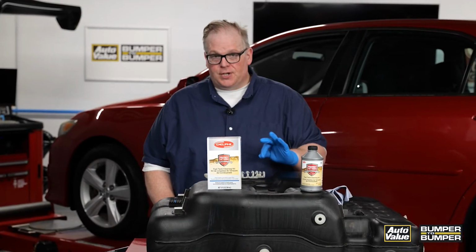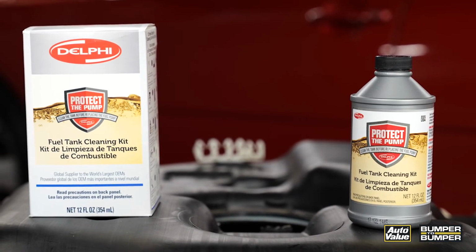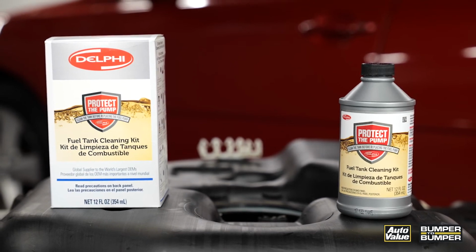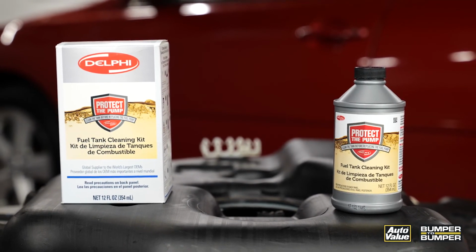Also, another suggestion, make sure that when you pull the fuel out of the tank, if you intend to reuse it, chances are your customer is going to come in with a full tank of gas. Make sure you're filtering that fuel before you put it back in the tank. With this kit, it's possible to create a nice, fresh environment for the new fuel pump so it can last a very, very long time.